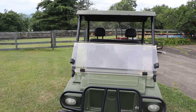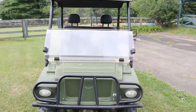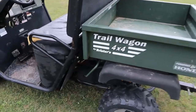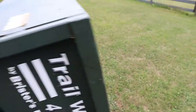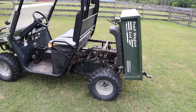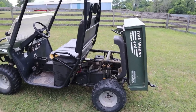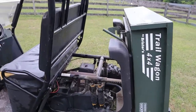The windshield is the only thing I bought from American Landmaster. I called them up, told them which model I had — it was actually available on their website, you just had to differentiate this one from one of the older ones. It's got the dumping box in the back with this little lever right here — you just lift up on it and it dumps completely. Tailgate opens and you can get rid of whatever you have in there. It is a manual dump. I thought about putting a 12-volt linear actuator on there — it would not be a big job if you have any skills in that department — but I just haven't really decided it was worth it.